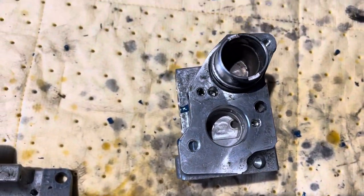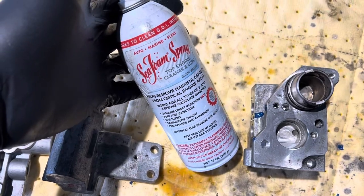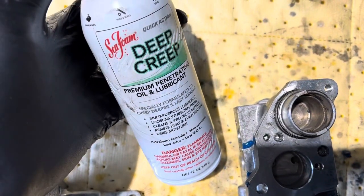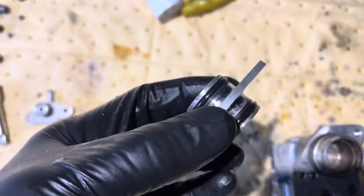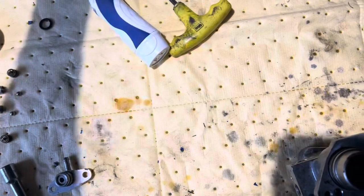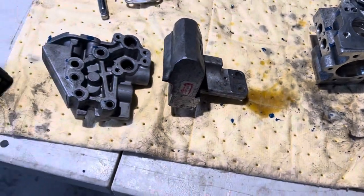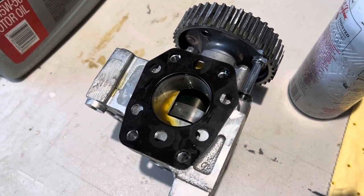You need to use non-ethanol fuel and make sure you use some Seafoam. These are the products I'm using to clean it. Seafoam cleaner is the product I use to loosen up everything. Your o-rings are going to be tight when you try to squeeze them out — spray this on there, it loosens them up so you can twist the o-rings and things out. And you want to use some carb cleaner. It's going to take you about two hours to do it. It's well worth it — get that pump out of your boat motor, your 200, and get this thing performing the way it was supposed to.